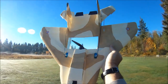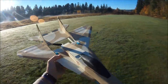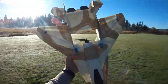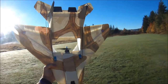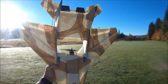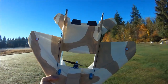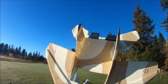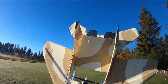What I'm going to do — because this plane is purposely built smaller than most park jets — is eventually swap this motor into another plane. I have an RC Powers F-22 Version 5 with the other RC Timer quad racing motor. I'm going to swap it in and see if this is actually a more powerful and faster motor — it's slightly bigger and has slightly more KV. These little quad racing motors, in the right plane with the right setup, are really good bang for the buck. They punch above their weight for sure.